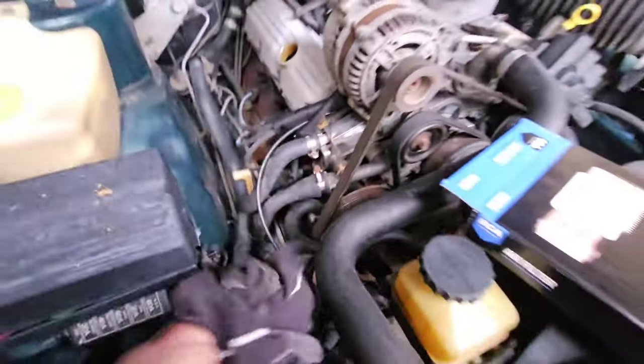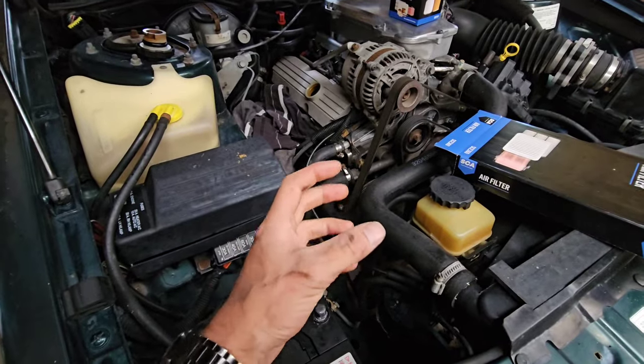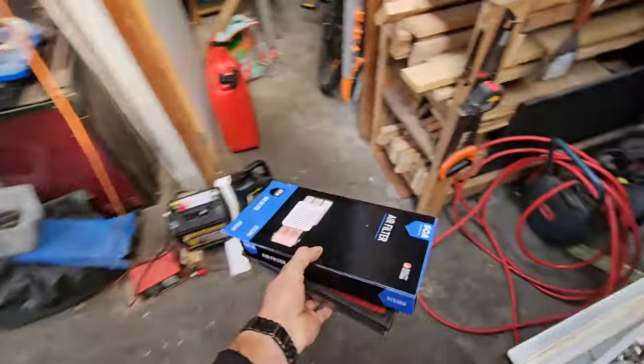So he's on nice and tight now. As I said, up to the seal. Can't see anything of what I'm doing down there. Have it up to the seal, you butt the filter up till it goes firm, and then about 3/4 of a turn, nice and tight. So oil and air filter done, let's get rid of the old.